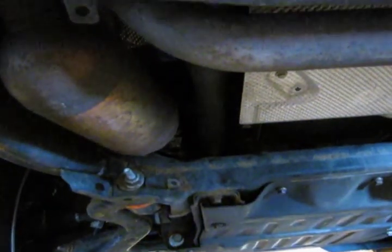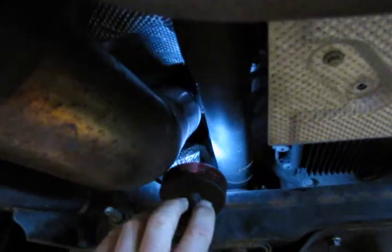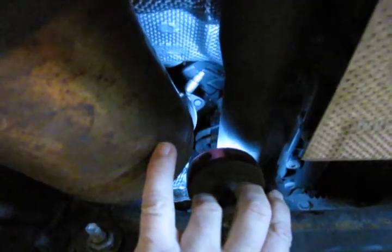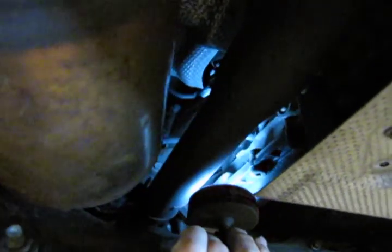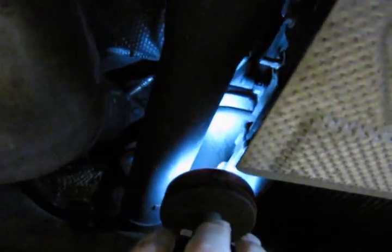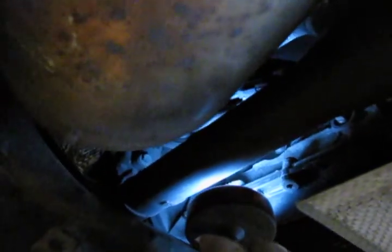That's the one that's pretty much hidden more than any of the others. As you can see, it is up there, and to your right you'll see the black connector. Access is a little tight, but if you remove the lower steel shield — which is basically 10 bolts — and the shield is out of the way, you can sneak your hand up through this area and reach the connector. Do this when the engine is cold, because if you've run the vehicle even for a matter of three or four minutes, these catalytic converters get pretty warm. We don't want to see you burn your arms on it, so try to do this when it's cold.